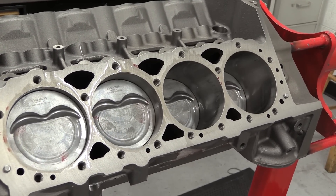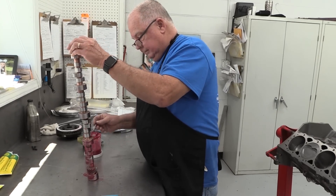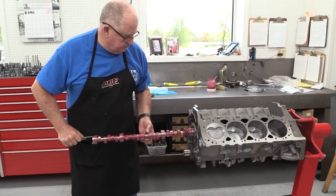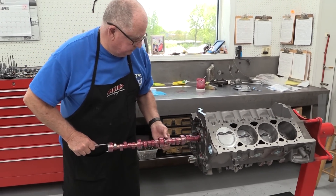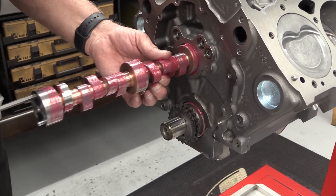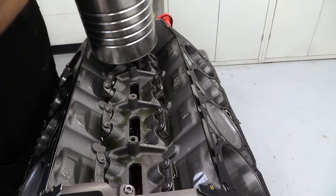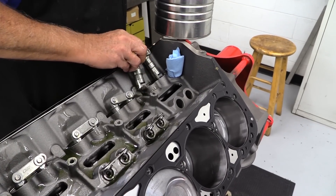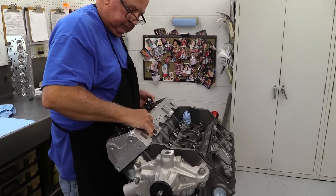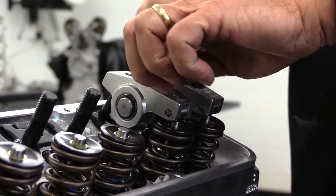There's also a lightweight 1.2-millimeter ring package and coated ACL bearings for both the rods and mains. The valvetrain is a hydraulic roller — both the cam and rockers are from Crane Cams. The camshaft is a billet roller with 236 degrees of duration on the intakes and 244 on the exhaust, both at 50 thousandths of tappet lift. Combined with the 1.52:1 ratio aluminum full-roller rockers, total valve lift is 548 thousandths on the intakes and 558 on the exhausts.